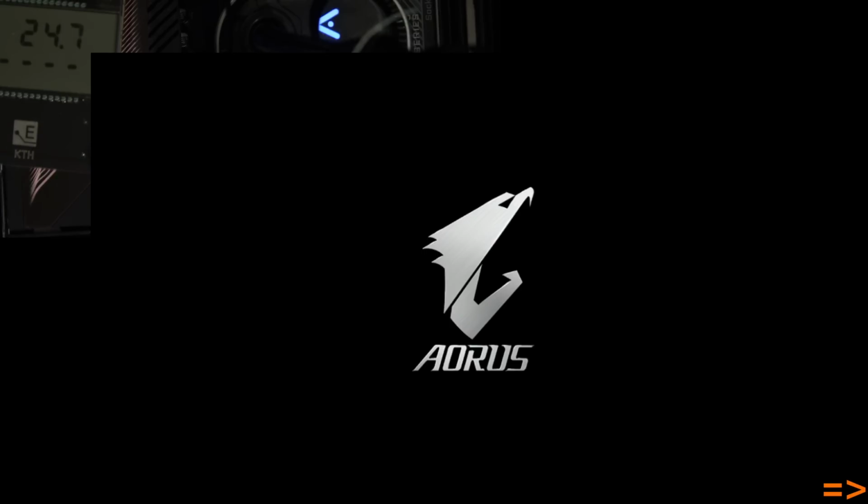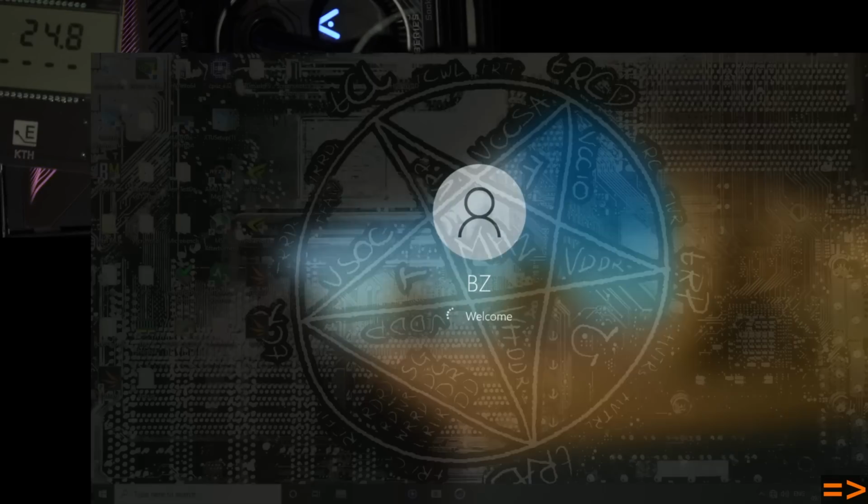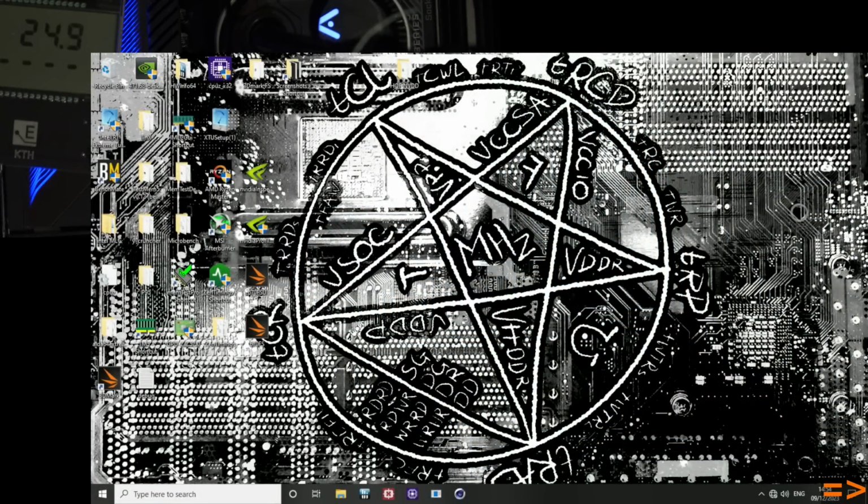So yeah, I definitely overshot it with the voltage at the start of the video. That's what I get for not being patient with my tuning process. I was running way more voltage than necessary, and I was losing frequency to it. Yes, I was losing like 25 megahertz to it. But at the same time, you can't just keep lowering voltage and the clock will just keep going up, because it doesn't work that way, right?